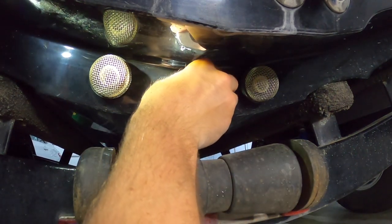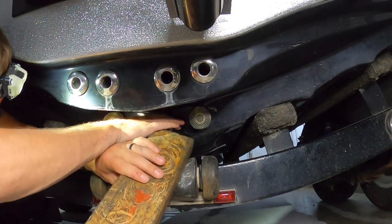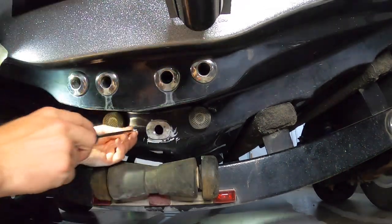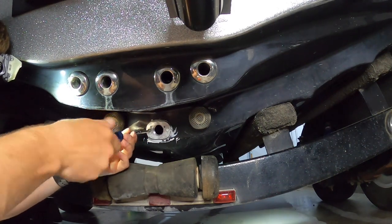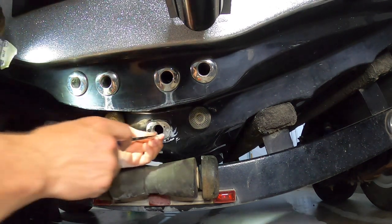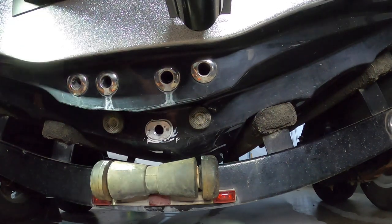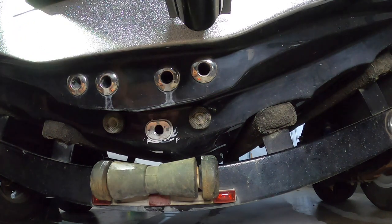It's not the greatest looking with the hole in the tube, but it's going to work. We're going to press this on here and get a nice good fit — basically want this to be continuous so you don't have any spot for water to get through. Then we'll go ahead and put the set screws in. Once we get it all situated, we will wipe off the excess. This is a pretty snug fit, so I'm going to actually line it up with a 2x4 and tap it in all the way to get it seated. We've got it driven in there — get the screws started and get them both started before getting them all the way home so they find the right spot. Got those tight. Now we're going to clean up around the drain plug and get that excess 4200 off before it hardens up.